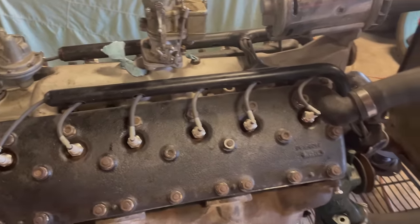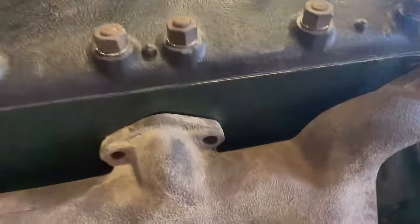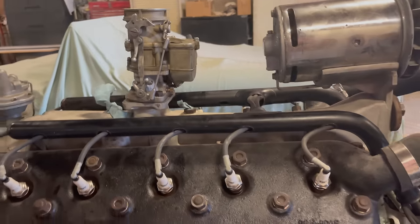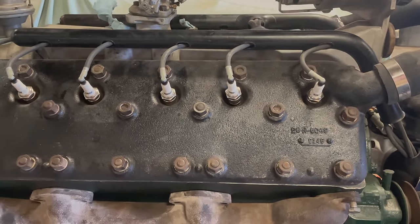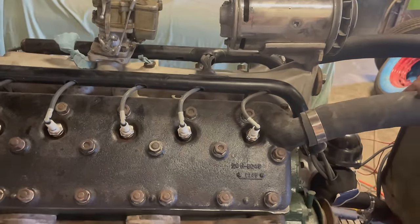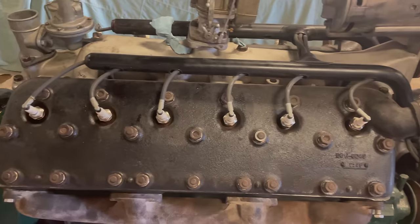I look in the exhaust ports and spark plugs for any richness. So in the exhaust ports, you're looking for a lot of dark carbon, real heavy carbonization, heavy oil burning, too much fuel in one cylinder, or a white valve on the exhaust, to make sure it hasn't dinged out and burned. Okay, so you want the valves to all look even. Yeah. And then what do you look for on the spark plugs? Just the same color, as long as it isn't one white and all the rest black.